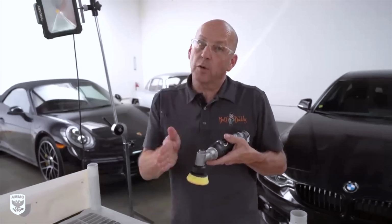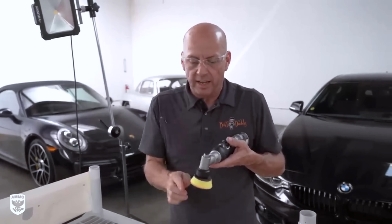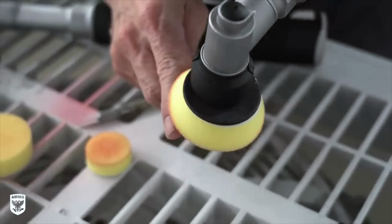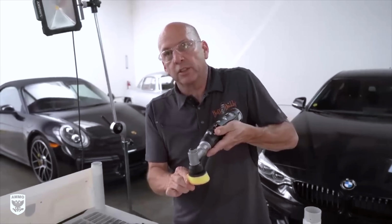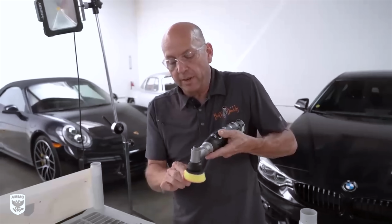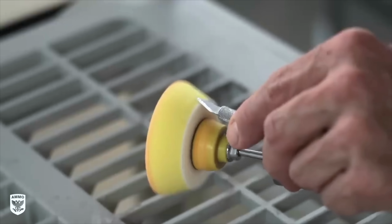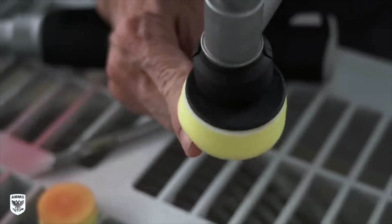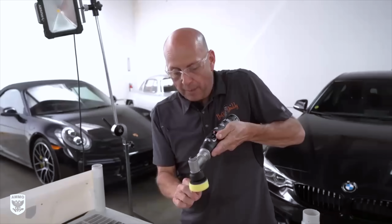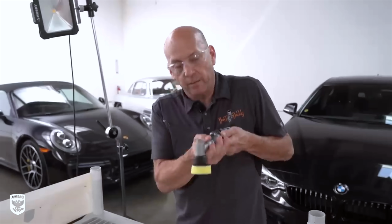If you're trying to remove a defect along an edge, tied up against the fender where it meets the hood, somewhere like that, and you wanna get just right up to the edge with the pad and put some pressure down, well, there's no backing plate support for that, so it just squishes, okay? So by eliminating the flare in that situation, now when we do some pressuring, you've got backing plate support. Directly below the backing plate, you're gonna get the most cut from pressure and tilt.